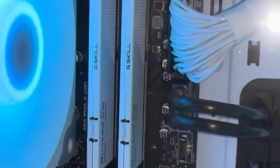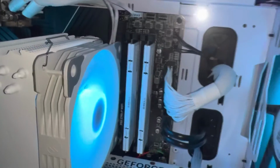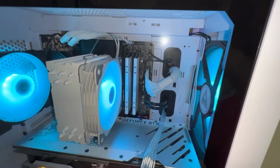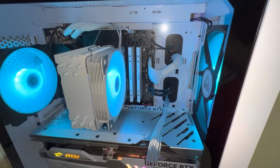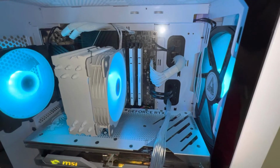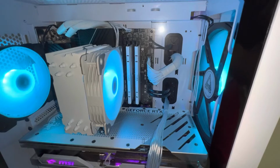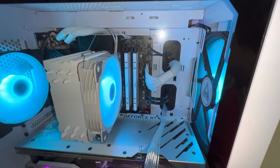And the other one's down here. Can't see it as easily. That's for the rear. I've got some system fans down here. You can see sysfan 5. That's where the other one's plugged in. So if you're having a similar problem, you can do the same thing that I was doing, which is plug these in directly to the motherboard, and then you'll be able to control the fan speed right from the BIOS. Otherwise, if I didn't go sort of half and half like that, like I said, I was getting 0 RPM.